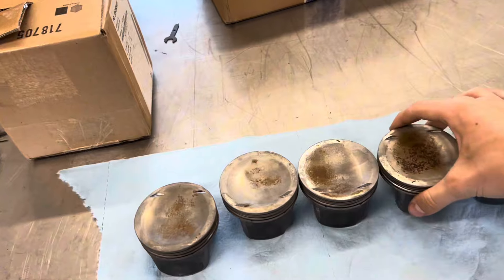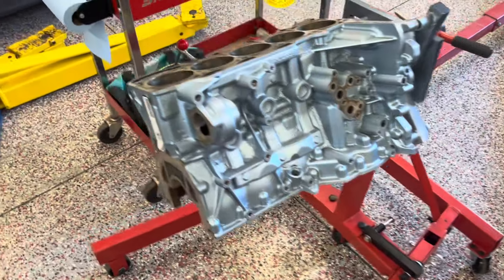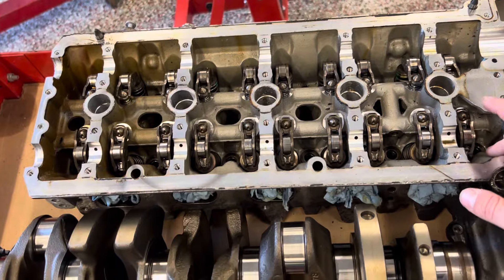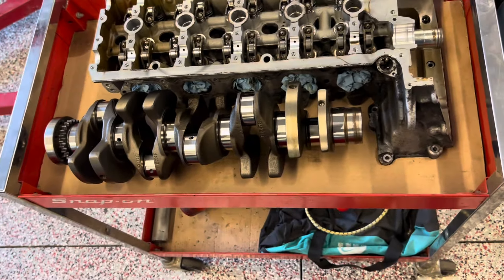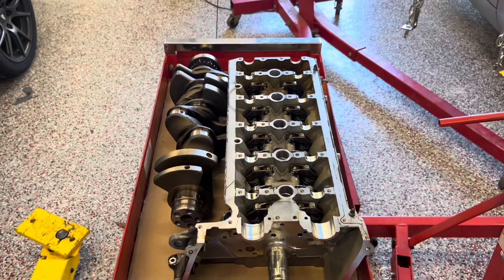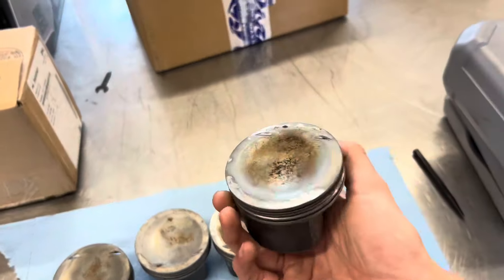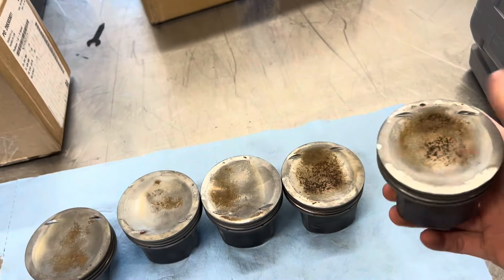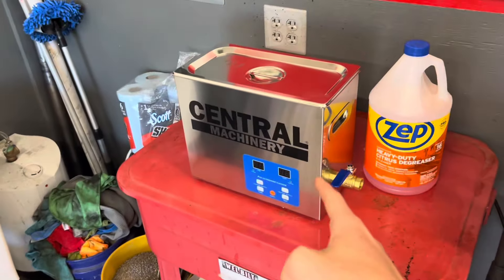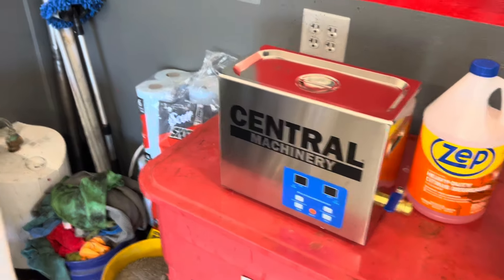Over here we have the pistons on the engine. In the last video it was kind of a whole jumbled mess, but since then we have completely taken it apart. Here's our cylinder head with the camshafts taken out, all the lifters still in, along with the valves and valve springs, and then our crankshaft here as well. We're going to keep all this stock, because the stock internals are good for about 400 wheel horsepower — a lot of the guys on the forums have been saying that with this specific engine. The pistons were really crappy on top with intense buildup, but it was very flaky so it came off easily with the new ultrasonic cleaner we got from Harbor Freight. My dad did a review on that — I'll link his channel in the description.